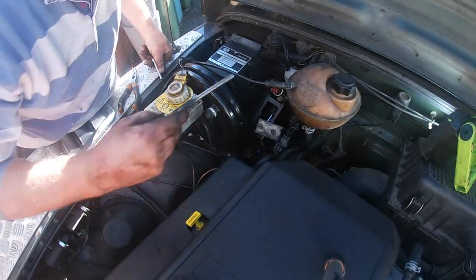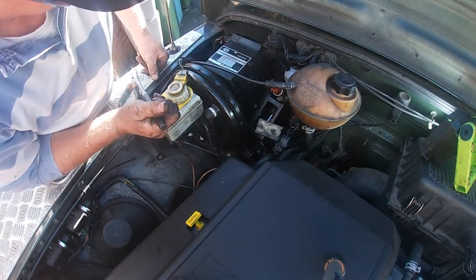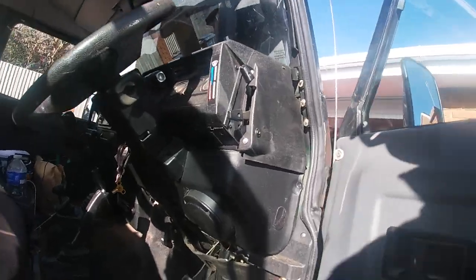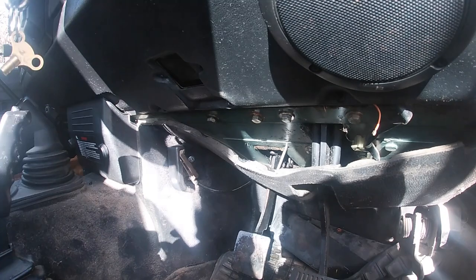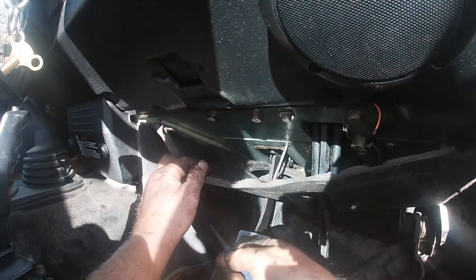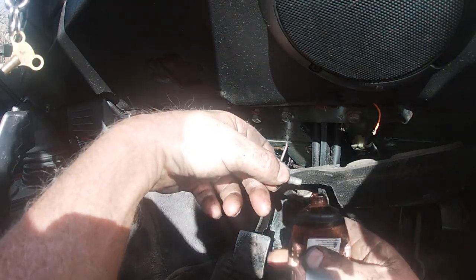The next job was to get the six holes to line up through the bulkhead into the clutch pedal assembly. What I did, I used a punch as a podger, which really helped, and also you can wiggle the clutch pedal in various directions until you engage with the bolt holes in the housing. Once again, I applied copper grease to all threaded parts.